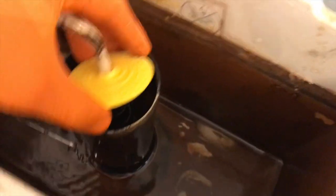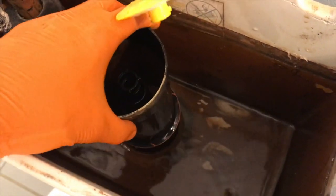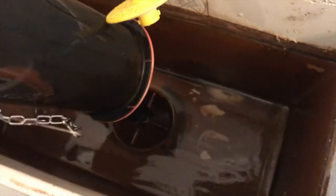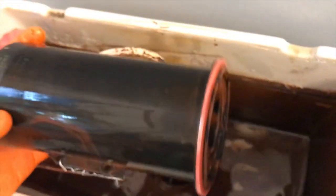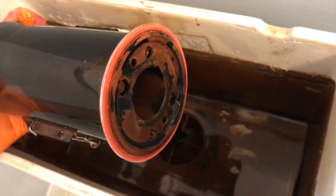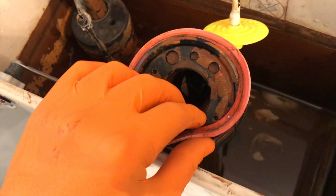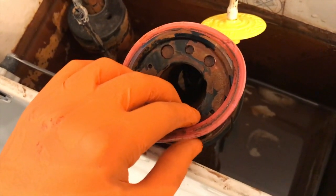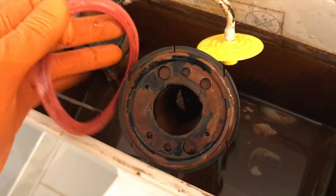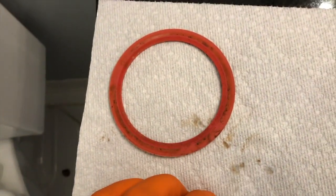Pull up, and on the very bottom of this is a seal — make sure you do not drop that. From here we are going to carefully pull the canister up off that inner cylinder. There it is — there's the rubber gasket. As you can see it's pinkish-reddish. We are going to carefully remove that. Take your finger or a small knife, but if you use any tools do not scratch the canister, because it requires that actual shape for the gasket to create a watertight seal. Take this off and put it in a plastic bag.